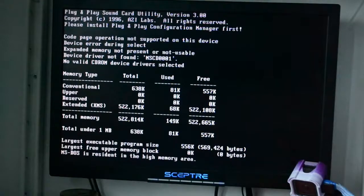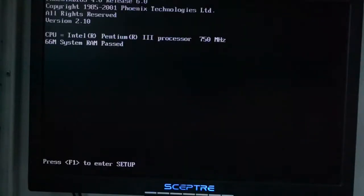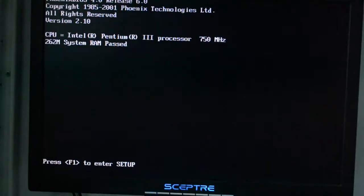I pressed escape, so. It's kind of doing nothing. Well, the numlock turns on. I think that conflict is causing issues. So what I might have to do is open it up and take that video card out, because that might be a bridge too far for this thing. Let me get my bicycle helmet out of the way and turn this thing on again. I've taken the offending video card out. I guess I can work on it later if there's a way to get rid of that resource conflict.